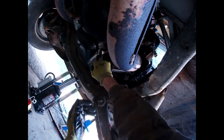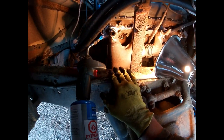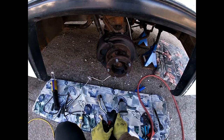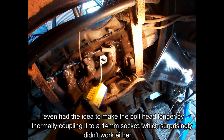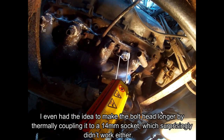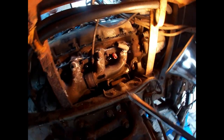Small victory I suppose, but I was still stuck with these manifold bolts, not being able to get them off or heat them up. I went back to the propane torch, trying to use that to heat the bolts up, but propane is just not hot enough. I even started exploring the possibilities of getting an oxyacetylene setup, and then I looked into MAP gas and MAP pro gas. But really, at the end of the day, none of that was going to work for me.